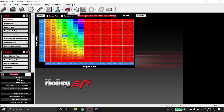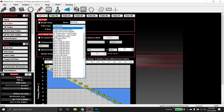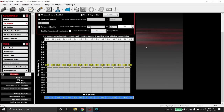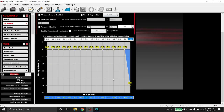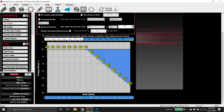After that, we look at timing through advanced tables. We open up our advanced ICF 1D table. I just name it idle timing — the table type is a timing offset and the x-axis is RPM. I zeroed it out intentionally so I can walk you through this. If our target idle is 1,100 RPM, we want no change in timing — zero degrees. If it idles at 1,500, we need to remove some timing, so knock five degrees out of it there. Come up to 1,100, left-click and hold, drag over, right-click, and hit fill row values. If the engine tries to idle up past 1,100, it's going to start pulling timing out.